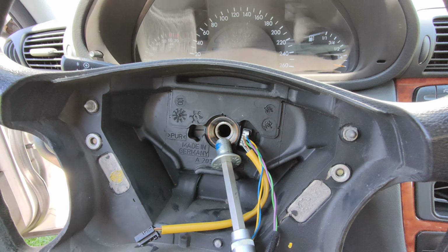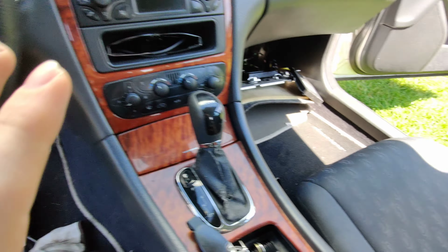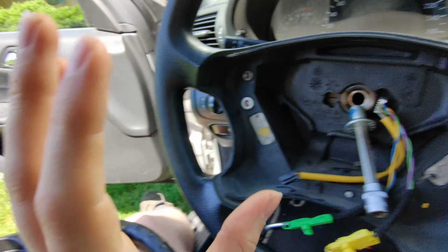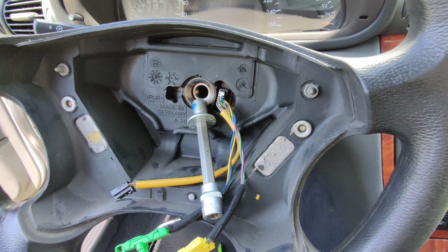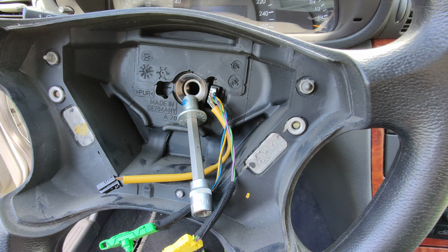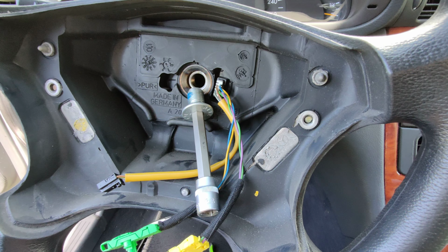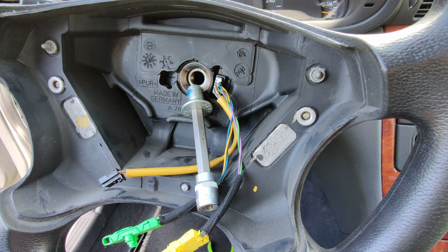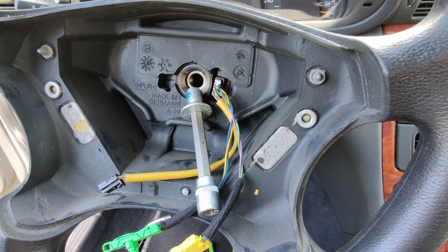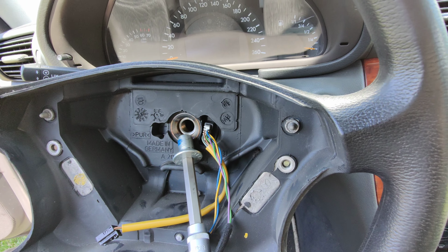and will become loose. And then what I advise you to do is to switch to the passenger seat, face the whole airbag to the open door, just in case, and make sure that at this point the battery is really disconnected. And once you disconnect the battery, just wait for a while, so all the systems will have time to power down, and then you can proceed.